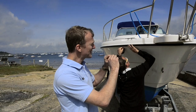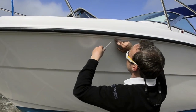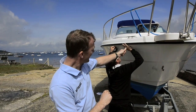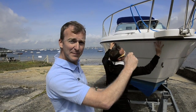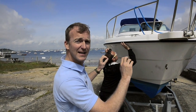The next stage is to prepare for the vinyl, which involves putting a vinyl cutter — a very thin filament of Kevlar — which Phil is applying here, so that you can wrap over it. Then when the wrap is all in place, you can simply peel back the filament and it'll cut the wrap like a cheese wire, leaving a very nice, clean, sharp finish.